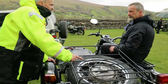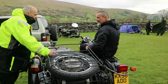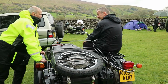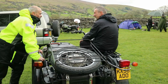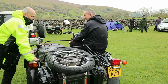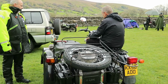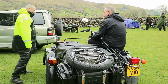What you've got to watch with these is you get oval drums. Yes, I know. Put it on the front, and the thing's doing that. But it's not so much that it's worn that way. That's how they were machined. Because the machinery that the Russians were using at that time was probably like old Triumph stuff and that. You know, when they were making stuff that was broken all the time. But the Dnepers were even worse for it. That oval drum. Sorry? Not back on the tool.